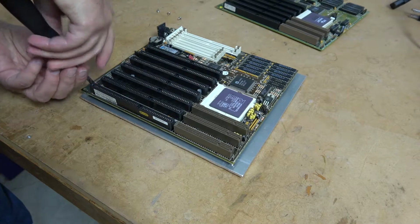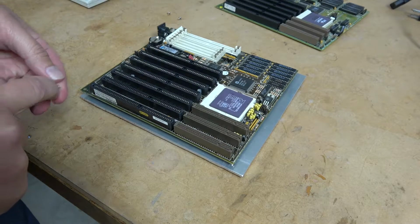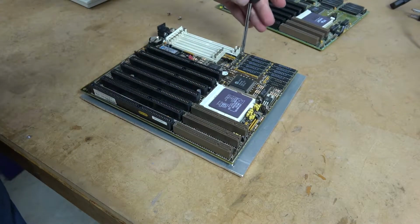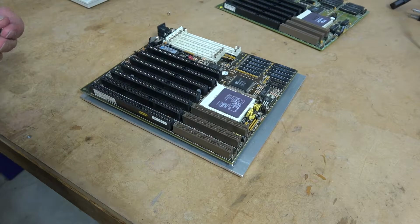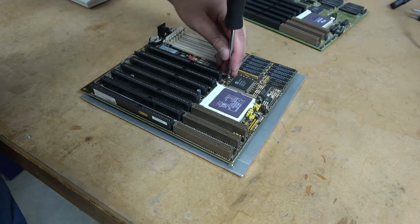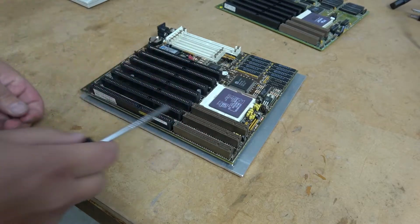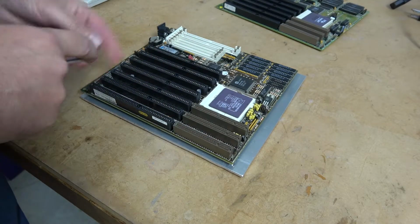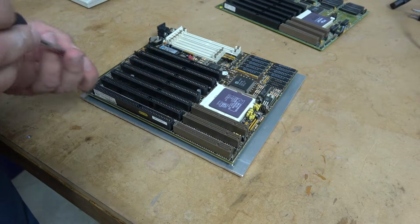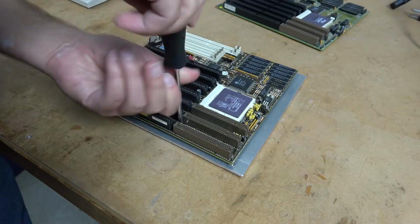And during this generation, they would sell regularly with cases these little red washers. Maybe I'll put a picture in the video. But those red washers were designed to insulate the back of the board when you installed your standoffs. You would still get a ground off of the screw contacting the metal chunk on the top of the motherboard, but there were issues where that standoff might touch a trace on the back of the board, and that red washer was to insulate it.